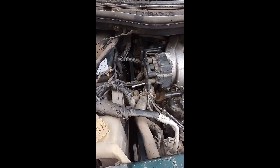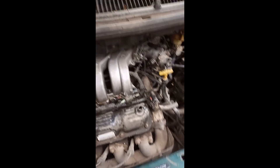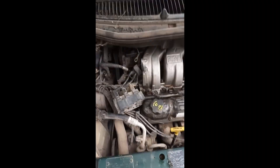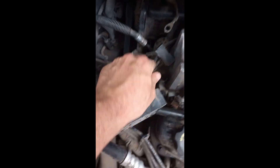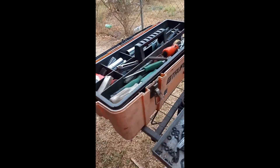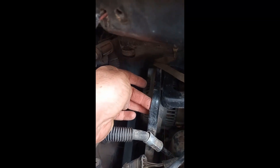Because I'm holding my phone and don't have my normal camera with me, I'm going to do this in stages and will come back after each item is removed. Remove the coil - just four bolts here, three bolts here. The big one is 15mm, the other two big ones at the back are 15mm, and these are two 13mms, with a third 13mm on top. That comes off and stays in place.